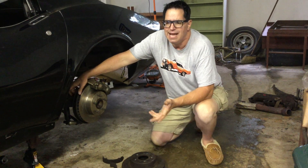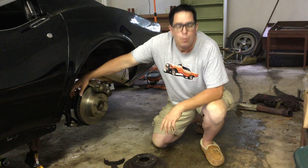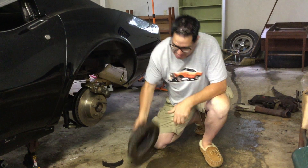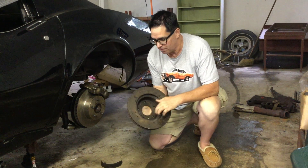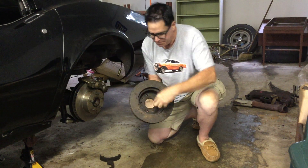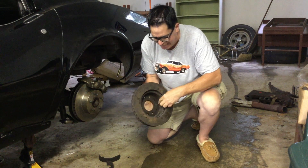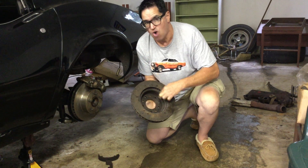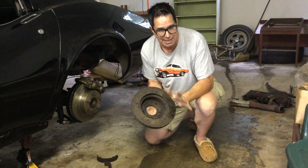But here's the thing: how do you engage a parking brake on a car with disc brakes at the front or rear? Well, on the Corvette they went with a special rotor with a built-in parking brake hat. Inside this rotor is this surface right here — this one is ancient, it has been used for a long time — but this right here is a miniature brake drum, and it was not meant to slow the car in any way, shape, or form.